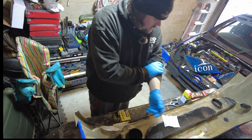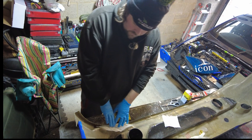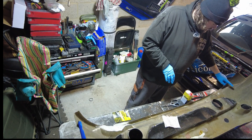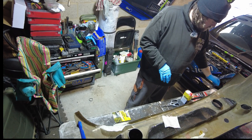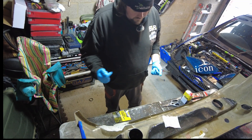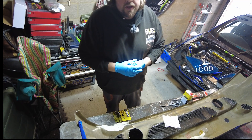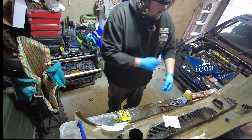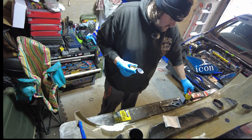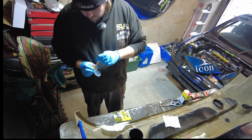Right, so we've got the bumper off. I've mixed up some fiberglass. This area here is where we've got the long running crack that sort of chipped the paint on the outside. So what I'm going to do is reinforce this bit here with a bit more fiberglass because I repaired that centre bit as well - that had snapped in half last year. And I've got this side as well which took a bit of fiberglass off. I'm not a body shop man, I don't know if this is how you do it properly, but this is how I do it and it worked. I'm using a typical fiberglass resin kit that you buy from Halfords. I wouldn't say I use things sparingly, but I use it properly and make sure I don't waste anything.